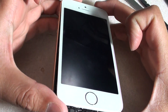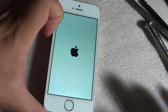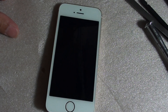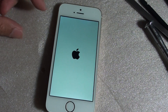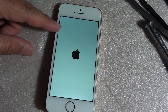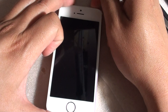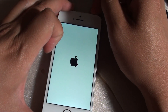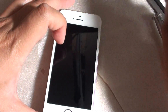We just wait for the phone to turn off before we can turn it back on. Now you can see it still has the problem — it is still in the reboot loop. I am going to switch it off and try to take out that camera cable. It is likely that the camera cable is damaged somehow and is causing this reboot loop.